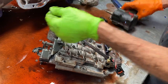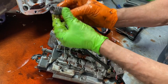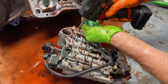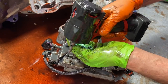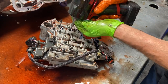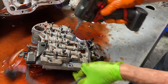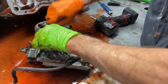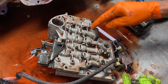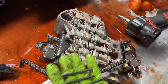This is our overdrive accumulator. This could be an aftermarket spring - most of them have a painted purple mark on them. Oh, there it is right there, so that's just a stock spring. This is the best part, going in here and seeing what people do to them when they build them back. I've done so many of these units that I can catch just about anything. Now these three bolts here are longer - you'll get them out and look at them. So you want to make sure you get the right three; all the others are the same length. Sometimes this one right here is a short and sometimes it's a long.